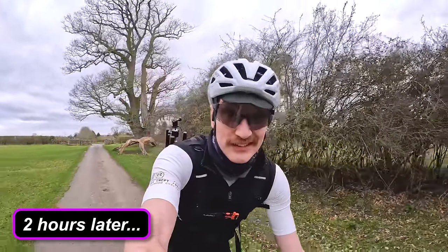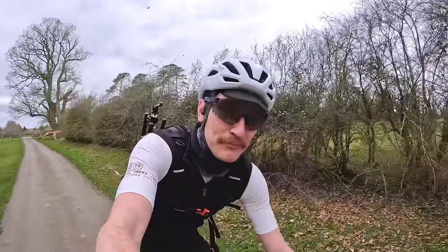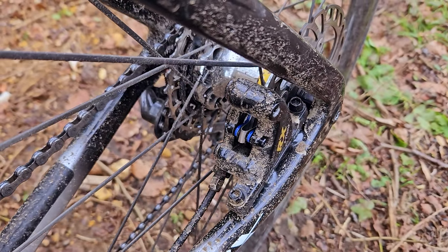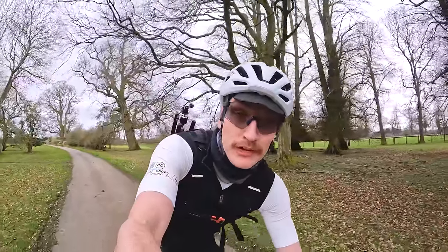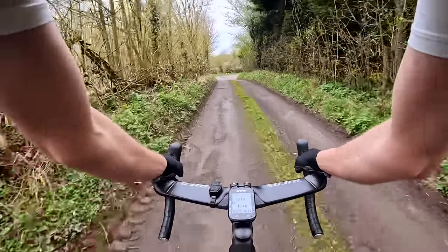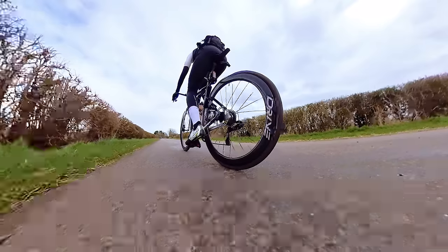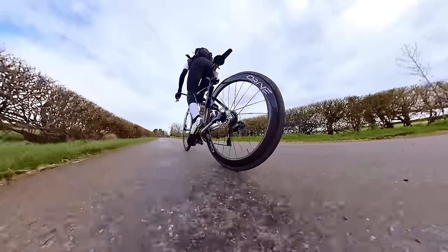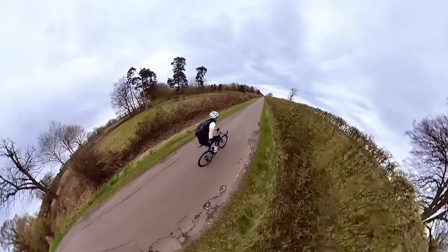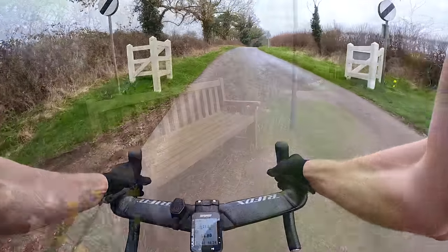After testing just the resin this morning and afternoon, it's clear this is going to be a multi-day endeavor. I kind of thought naively I might be able to bash this out in a day, but there's no way I'm going to get to grips with all the brake pad compounds in wet and dry, bed them in properly, and all that jazz in just a day. I spent the rest of the day cruising around, mainly country roads near me, getting a better feel for the resin pads. A bit of brake squeal to contend with initially. But because they're so soft, I felt like I burnt through them quite quickly. The bite from cold was honestly great — really strong from the moment you pulled the brake lever. For general riding out and about, fantastic. The rain did set in later, which was a bit miserable, and with the rotors wet you can hear the squeal.